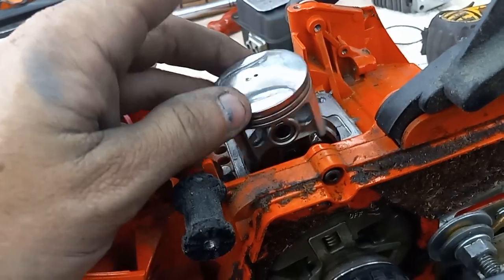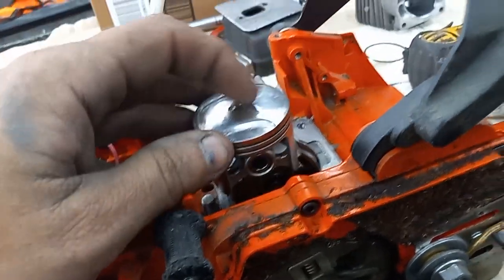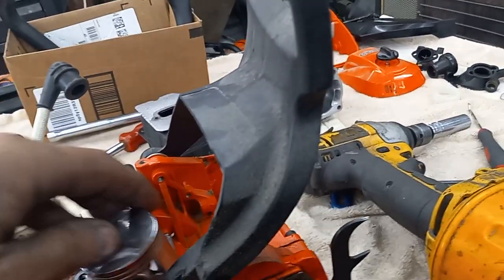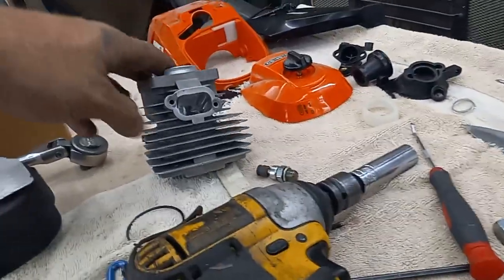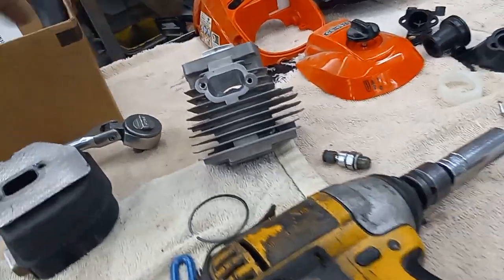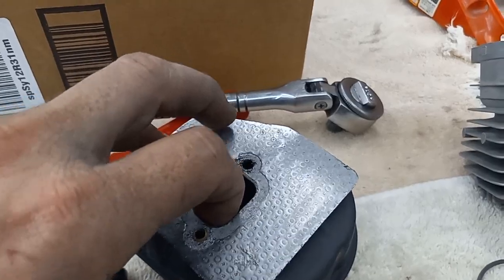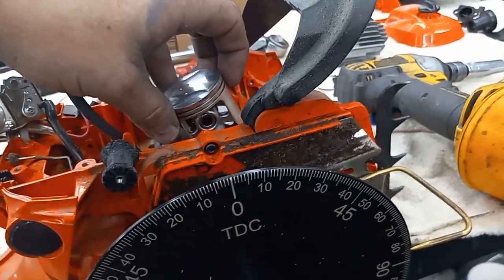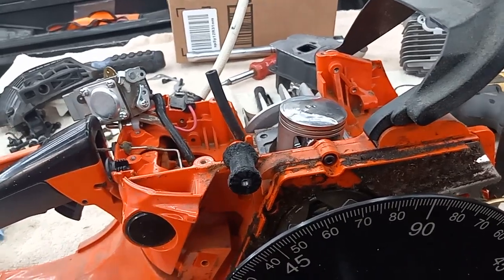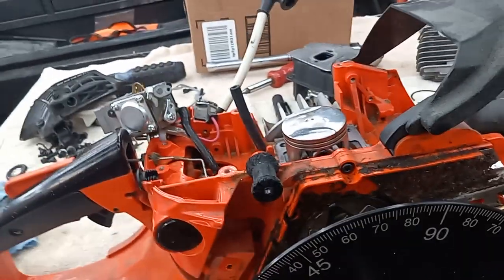Like I said, we're trying things. What's cool is if I don't feel this has enough torque or enough compression or whatever, all I've got to do is buy another piston and throw it in that same jug — then I have a totally different set of numbers and it should be a pretty rootin' tootin' saw. I did take the exhaust out a little bit wider on this one. I'm going to have to pop this gasket off and grind it out to match, and I know there are going to be two bulges here that'll interfere. This saw might be getting a pipe on it. I know if I throw a pipe on it I could for sure get my 6.5 horse. But I'm really shooting for piston-ported muffler — I'd like 6.5 horse piston-ported muffler.